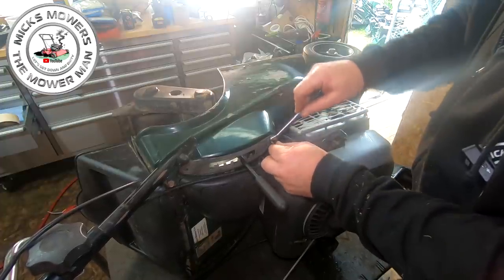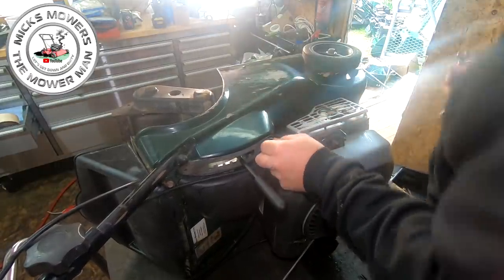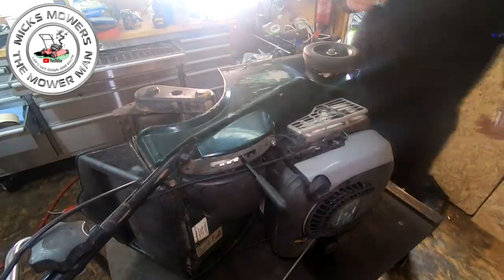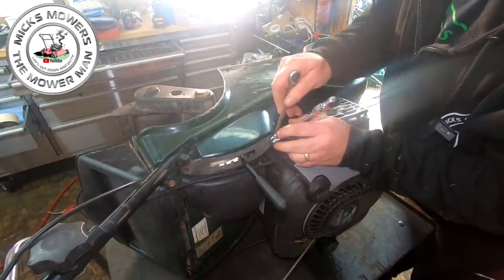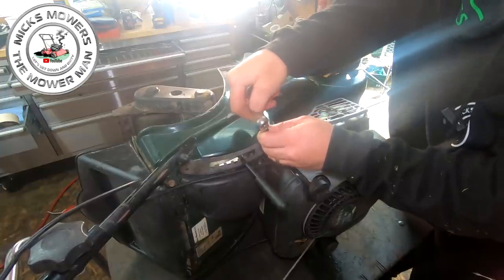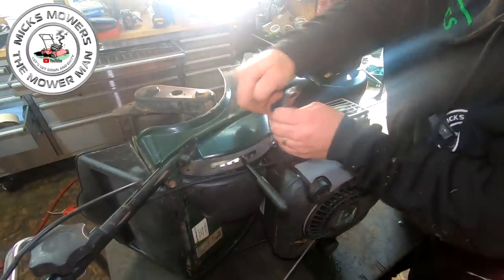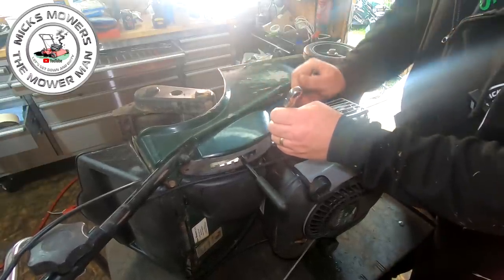That's all on together. And then I can try and just remove this one without that one moving. Might get two spanners, okay, just to hold them into place, so one doesn't rotate. Let me grab another 10mm and lock them off together, and then that way you should be able to withdraw it. So let's put that one on there to hold that still. That one on there, and then very, very carefully lock them up, and you should be able to then retract this stud. Okay, it's quite difficult to do, but you see what I'm doing. Just lock them off together, and then the whole lot should lock together, and it should bring that stud up evenly for you. Okay, so get that done, and I'll be back to you in two ticks.